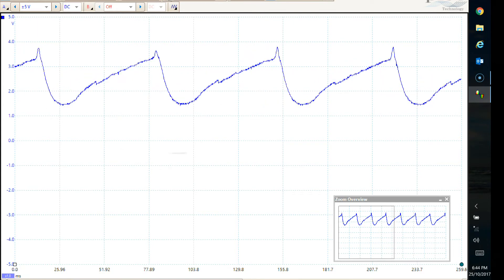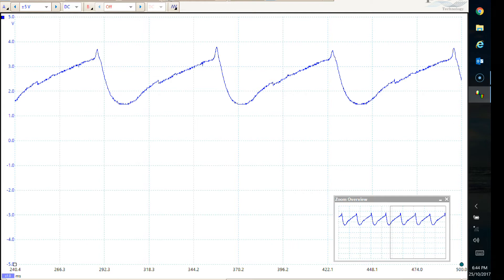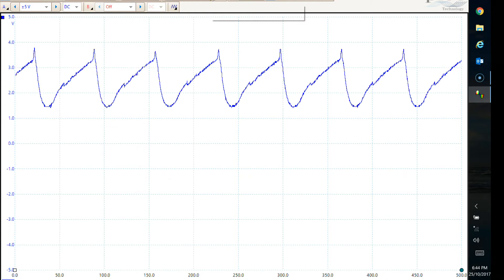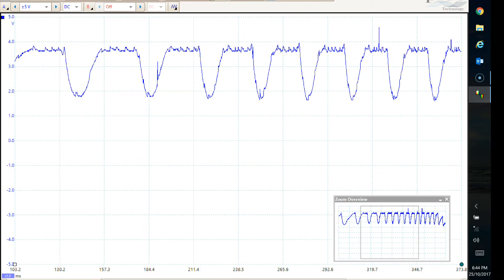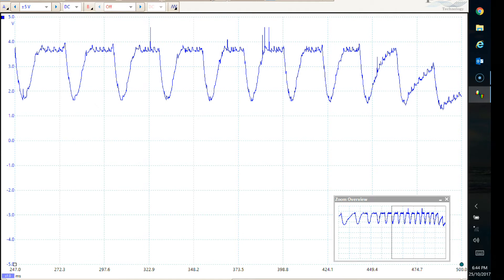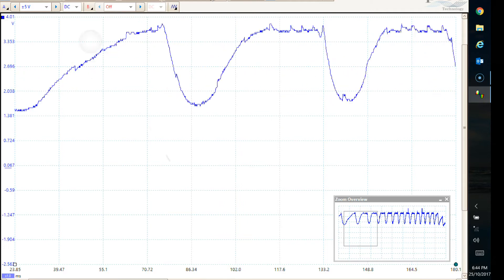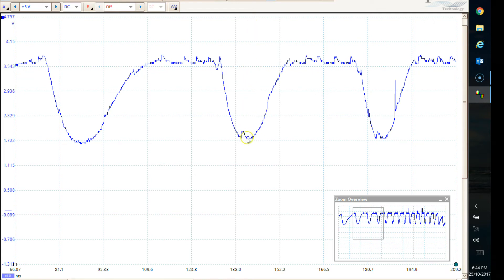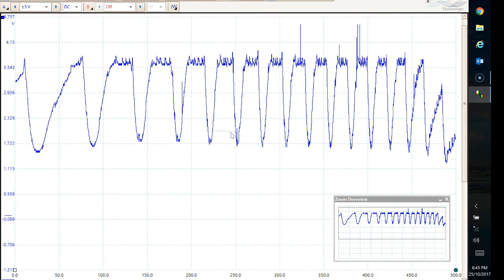So that basically is a known good waveform for the MAP sensor — or Intake Air Pressure Sensor, as this particular manufacturer calls it. We can go across to some other pages where I actually gave the bike a bit of a rev. You can see the waveform changes — this is a pretty high RPM, actually, but no load. And that's where the engine gets turned off. You can see the pressure inside the intake fluctuates quite a bit with each induction as the intake valve opens up. If you want to take an actual voltage reading, you can just put your cursor on the line and press down — we've got 1.809 volts at that point. And then there's a maximum pretty much up here of 3.75 volts, near enough. This is a known good waveform, and you can compare that to the waveform of a suspected faulty MAP sensor.